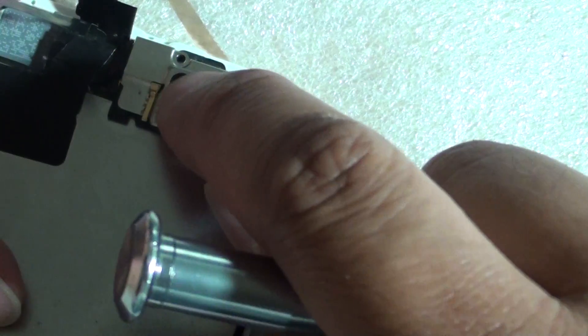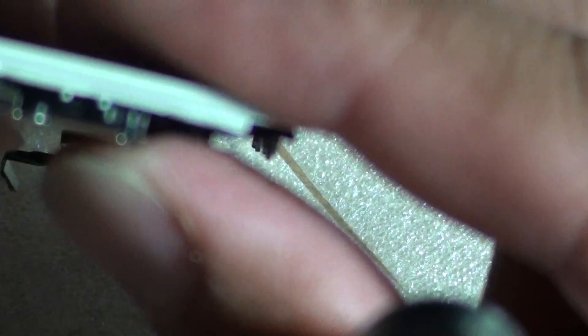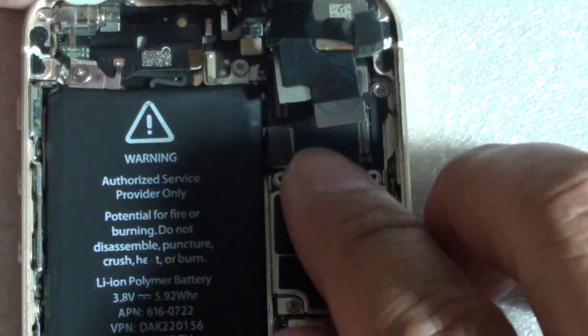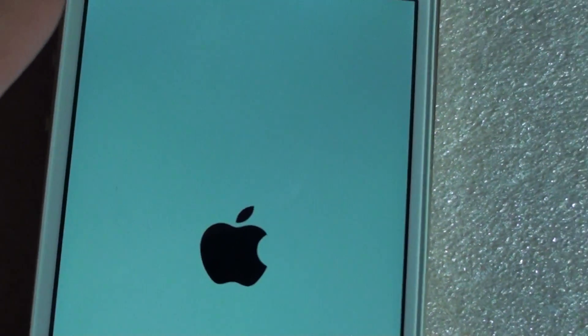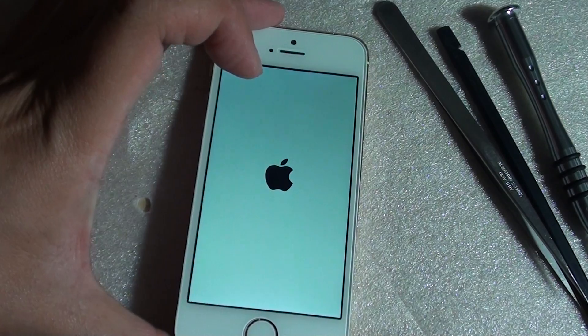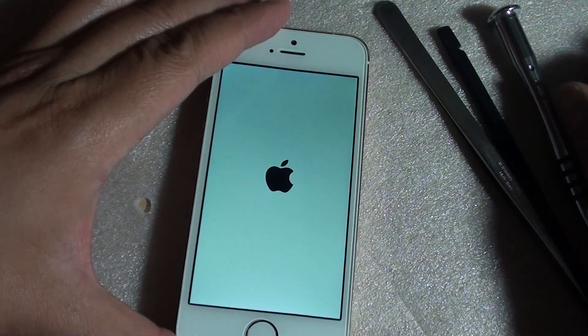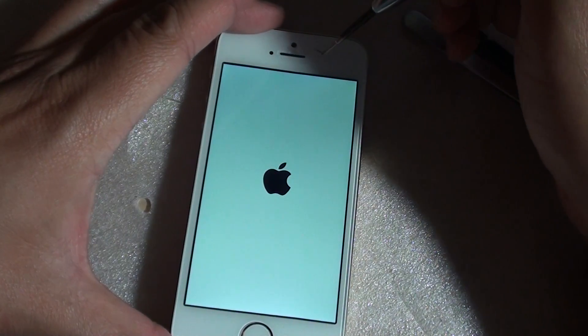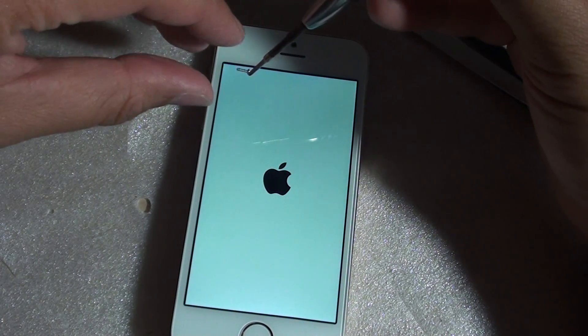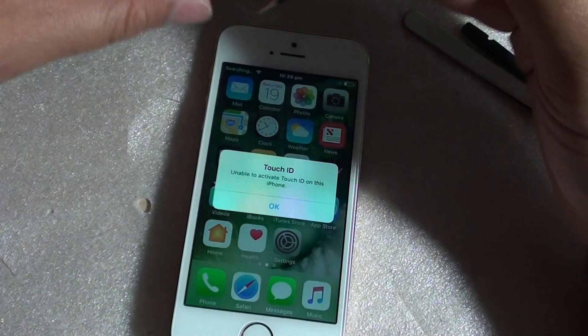There is another screw that goes in here — at the moment I am not going to put it in. We are just trying to see what is causing the issues. I am going to plug in the cables and start the phone to see if I am getting a rebooting error. It could be that the screw used for the camera is not the correct one — if the wrong screw is used, it can cause the issues. In that case, you might want to find the right screws. Now it is booting up fine.